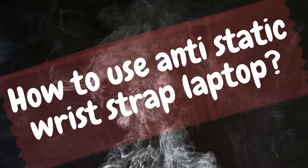Turn off the power to your computer. Connect the power cable from the power source to an electrical socket in your home. To secure the wrist strap, use an alligator clip. Attach the clip on the power supply patch's metal grill or even the PSU fan. To keep it firmly in place, you'll need a clip, so make sure it's fastened to the metal.